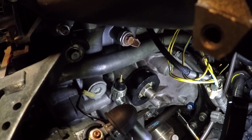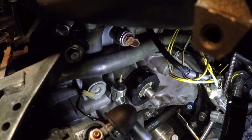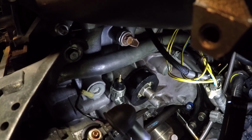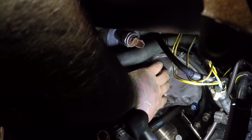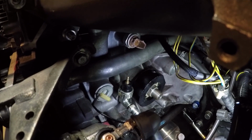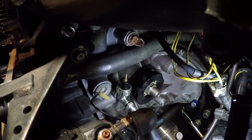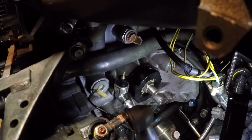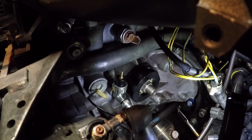I don't think it's gonna interfere if I put the oil filter on now. I don't think it matters anyways. I could just take the oil filter and sandwich plate off. So I'm gonna put the oil filter on now and run the hose if I can with the location that it's at, because the fitting's facing to the side, because I had to find a location where I could feed the line. I had to rotate it so I could feed the line, but it kind of feels like I'm gonna have to get a 90 degree to feed it, but we'll see. Right now I'm gonna put the line in, and then we'll go from there. But I'm definitely gonna have to get a crescent wrench or something just to get this one out, and then get the rest of it out so I could plug it up and clean it up. But let's finish up the sandwich plate and the oil line.